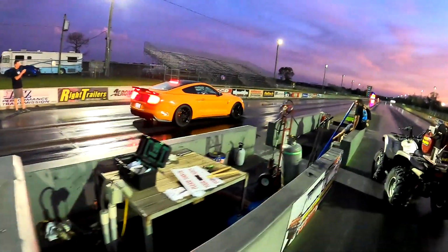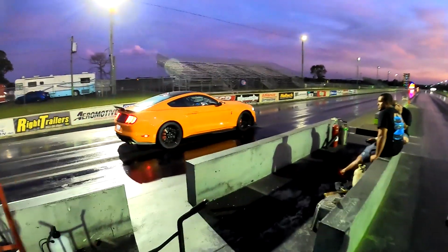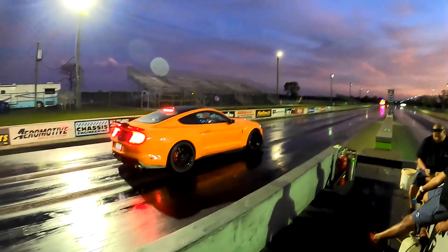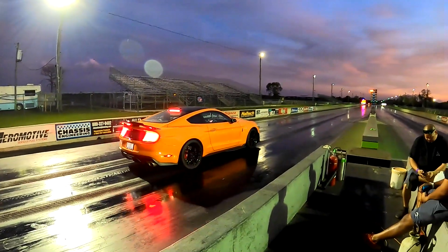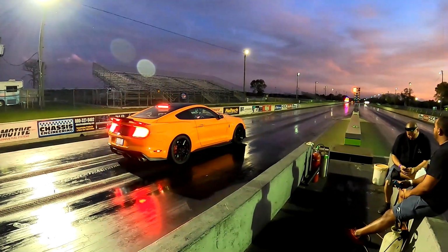Fairly mild tuning on this car, not very aggressive at all. And of course, there is no transmission tuning at this time for these. Can't even log what's going on in the transmission. So we found that raising the rev limiter and then manually shifting has been giving the best time.